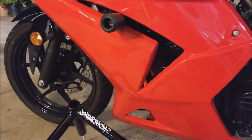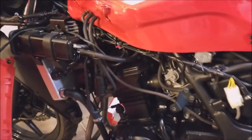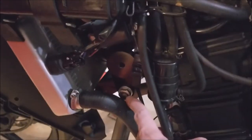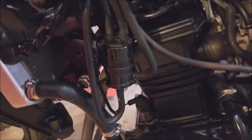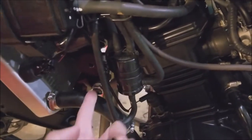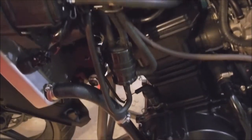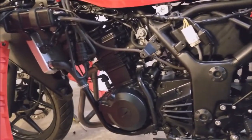That slowed me down a little bit — I was supposed to get this installed last night, but I had to wait for a friend to bring me the tools. Let me show you what I'm working on. Right there — that part is where the engine bolt is. It goes through the engine and the frame, so that's how the engine is attached to the frame, just by that long bolt going across. That's where the sliders are currently attached. I'm going to remove this whole assembly, replace the bolt with what they provide, and that's where the cage mounts from the top. I haven't seen any instructions online about a Ninja 250 for this cage, so I want to record this for future reference.